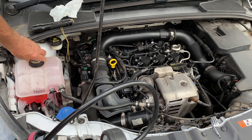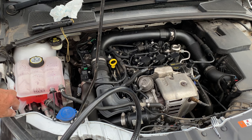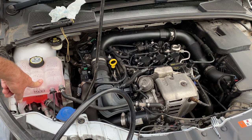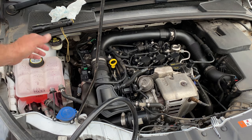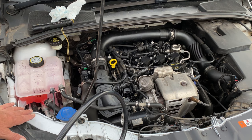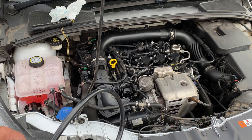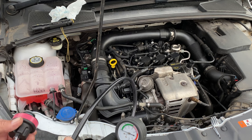It's a part they sell a lot of, so if you've got a Ford car keep an eye on your coolant. The bottle was cracked anyway, but I think the bottle was cracked and then the matrix went later — because that was fine for two months after I changed the bottle. Drove about 10,000 miles and the level didn't move at all, but the last week and a half it's been losing coolant. We had also noticed the air con inside the car — one half was cold and the other half was warm — which has something to do with the heater matrix and the vents.